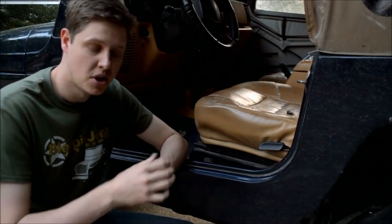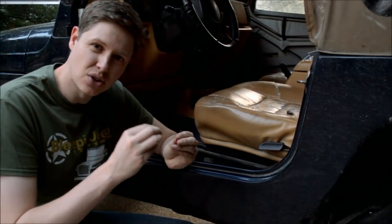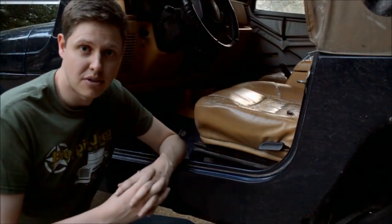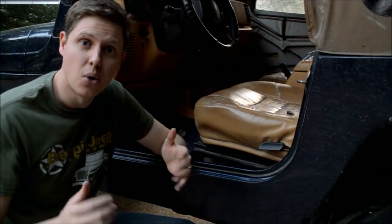For the 97 TJ, there's actually in the footwell right next to the clutch pedal a wired connection, similar to the YJ. If you have a YJ this might work for you too. You actually disconnect the wires and plug it into a nearby plug that is wired in and built to bypass this switch. You can switch it back and forth whenever you want to. I disconnected mine a long time ago and had no intentions of ever plugging it back in — just got to make sure I'm not an idiot and start the Jeep while I'm in gear unless I mean to.